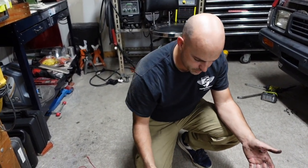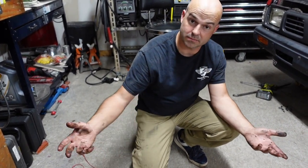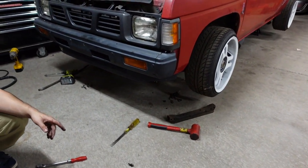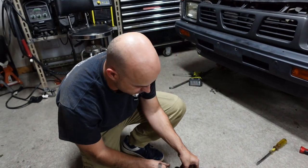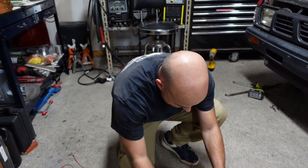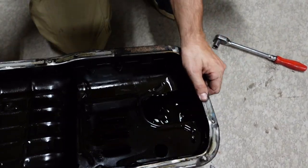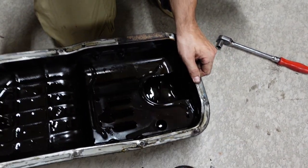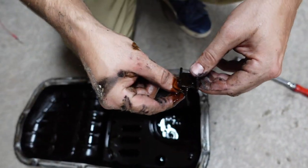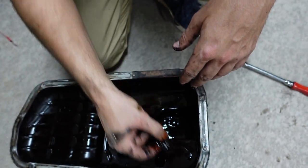Oil pan's off. If you didn't know this — and I didn't know this — hard body oil pans are super easy to get to. You take the little cross member out from under it, remove the bolts, and it comes right off. Don't forget to drain your oil. Listen to this — you hear that rattling? Big pieces of plastic in there. Timing chain guide debris. When Ronnie heard it in the bottom of the oil pan, he knew exactly what it was.